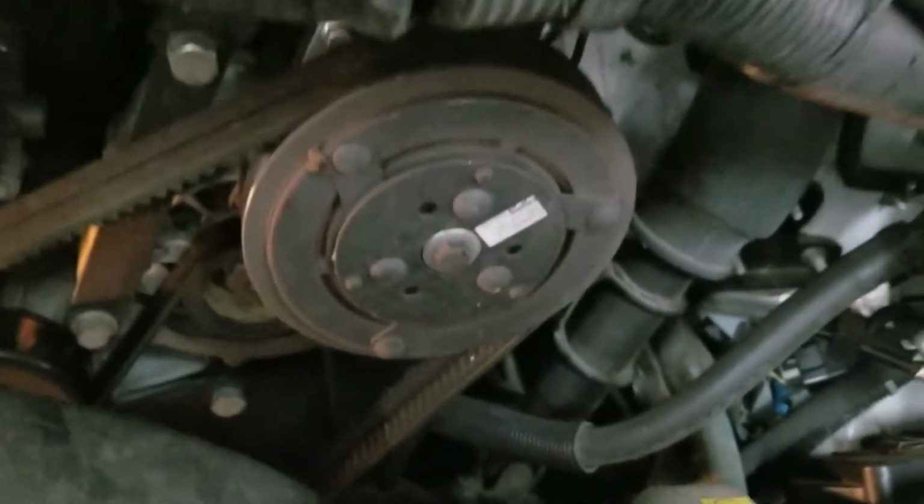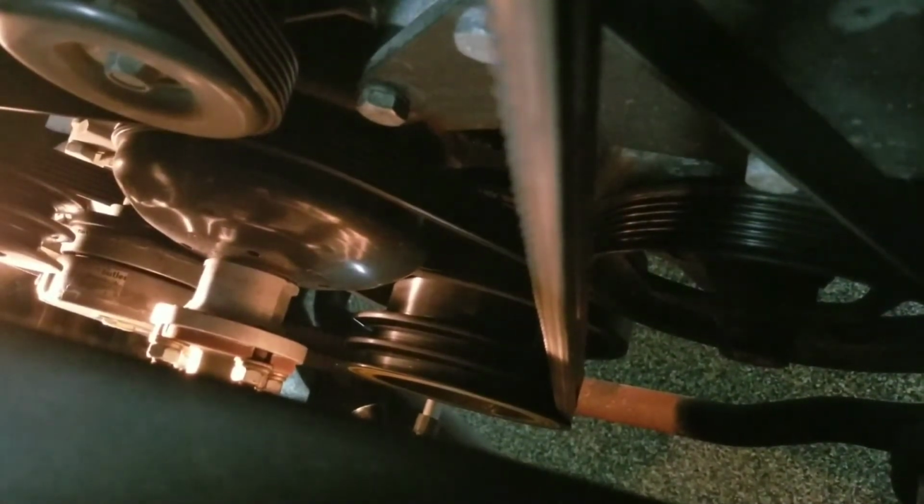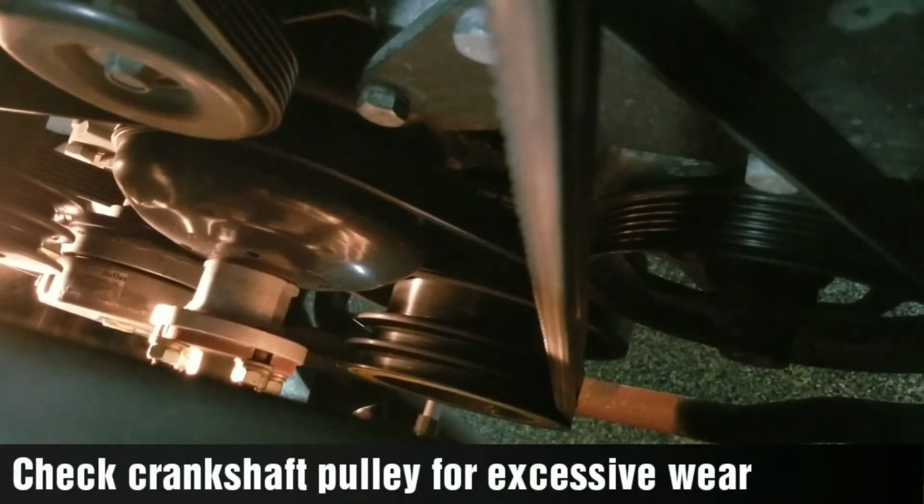Again, there's so much here, but it's really pretty simple. We do it even when they're hot, which I'll tell you is not fun. All the way to the bottom goes to your crankshaft. There you see that double pulley. Those will sometimes wear out too. If your Butler starts to bog, that's a problem. Those pulleys have worn, and that's like a $325 pulley, machined aluminum, and then you have to have it installed with a dial indicator. So plan on another $300 with your mechanic.